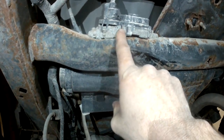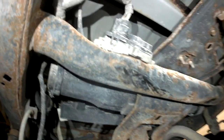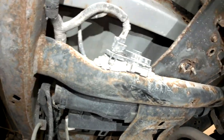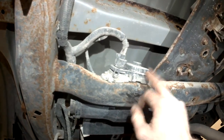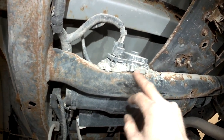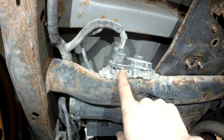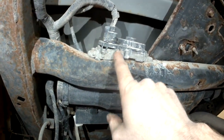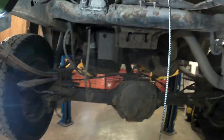You can see it's corroded and actually broken in half. This is not the first one I've seen like this. This is why I tell you: you can run fuel pressure tests and everything else, but the easiest diagnosis is to get it up in the air and take a look. You can see all the corrosion down in there — it's just broken, it's done. So we're going to pull that out of there.